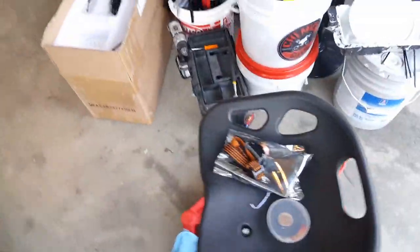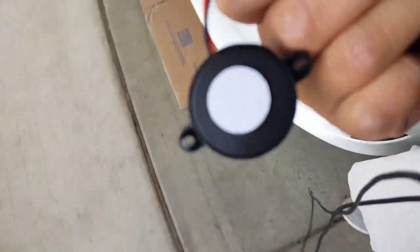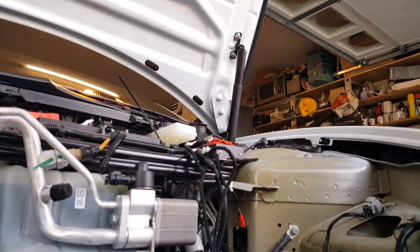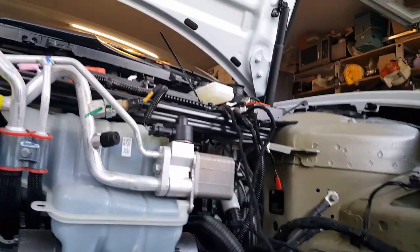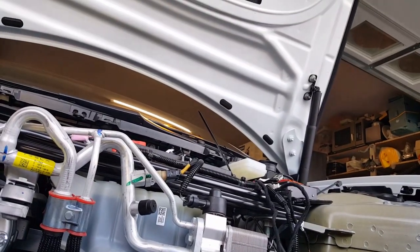So we're moving along quite nicely. And there is our power wire. And there is our speaker. We can attach the speaker now, just to get an idea. And this has a little small adhesive area already. Just remember, everywhere we need to put adhesive, we want to make sure we alcohol rub it, just so it will stay down. And it's nice if the temperature was a little warmer or hot, because adhesive always works best on a hot surface.